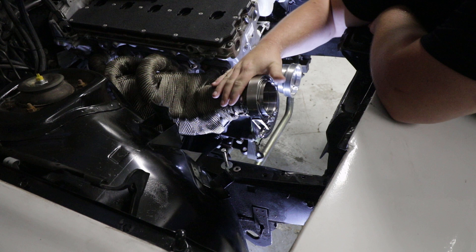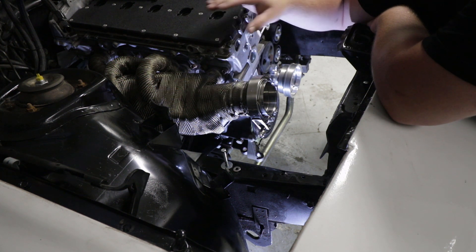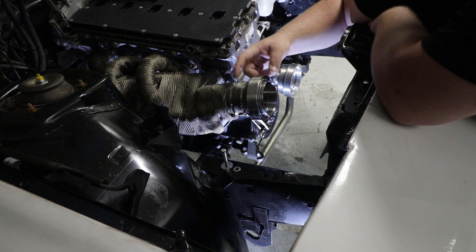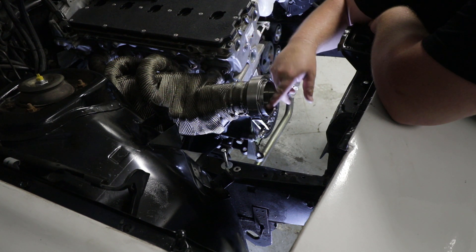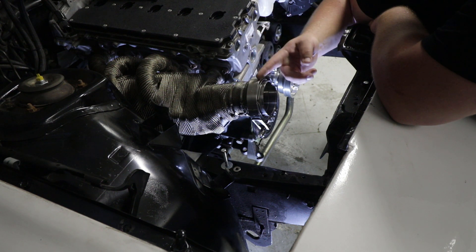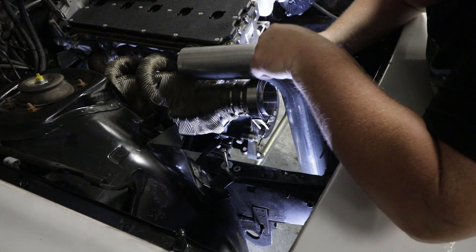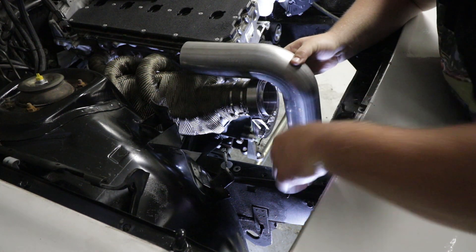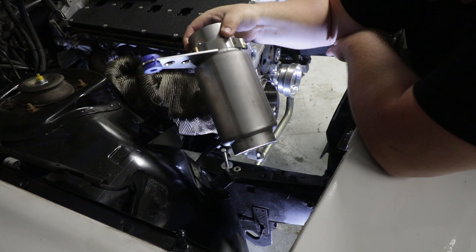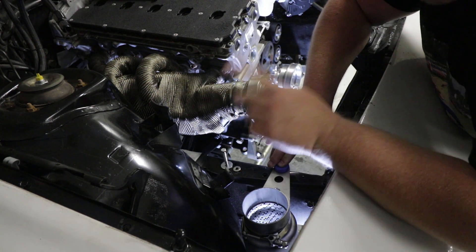So here's my plan of attack. We have the Lamborghini Gallardo header here. We have the five-cylinder 07K sitting in the car. I welded on a V-band flange to the end of the header, and now I need to figure out how the exhaust is going to come out of the car. My plan — and this is not going to be most people's plan — is to 90 down right here. I'm going to go straight down, then use a U-bend and come right back up through this hole, where I'll use this real tiny Dynamax race bullet muffler that mounts right here and then straight out the hood. Let's get to cutting.